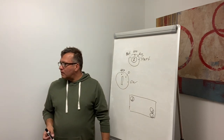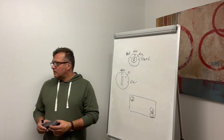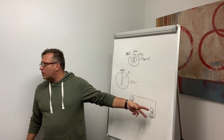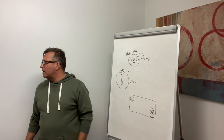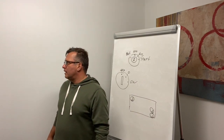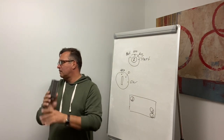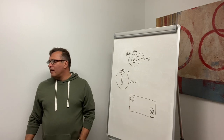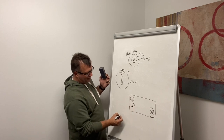The only thing we do about building up the pressure, once the air goes up to between 120 and 140, the only thing we have to listen for is the sneeze. One valid sneeze indicates that my air gauges are working properly. Okay, two things. It cuts off between 120 and 140, which indicates that both my primary and secondary are working properly. On the newer Freightliners, there is one gauge but two arrows, one black, one blue. So blue is secondary. Okay, another gauge is what? Oil pressure. And the third one is something like this, right? Like this.